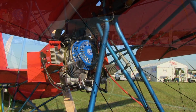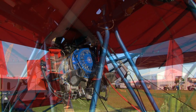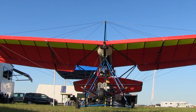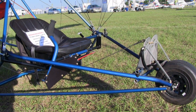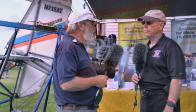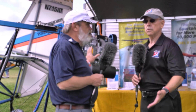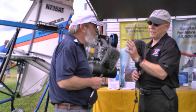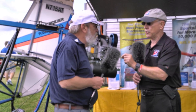Let's say I bought the Quicksilver, bought the engine, got it all up, and I'm flying it. Now I keep flying for a while — tell me about overhaul, tell me about service on the engine. Well, service is performed in Tiffin, Ohio. We perform warranty service, repair service, or a thousand-hour rebuild. This is a thousand-hour TBO engine. We recommend that at 500 hours you send it back and we pull the jugs off, clean all the carbon out, put a new set of rings in, all the bearings go back in along with a new set of gaskets, and you're ready for another 500 hours.